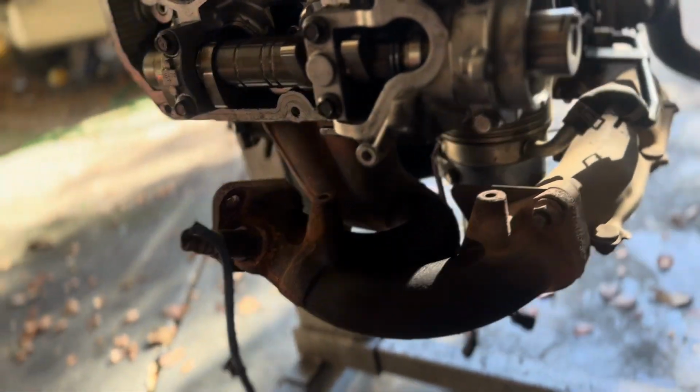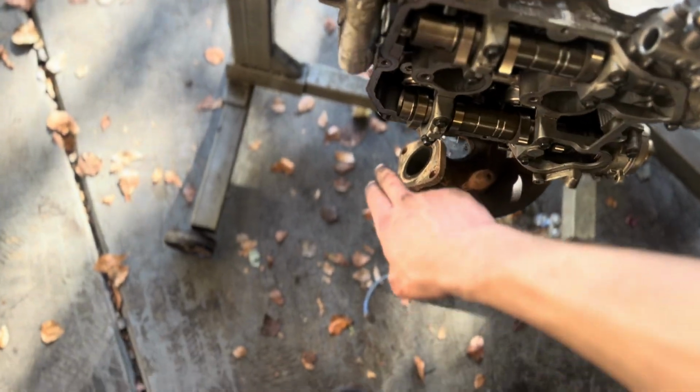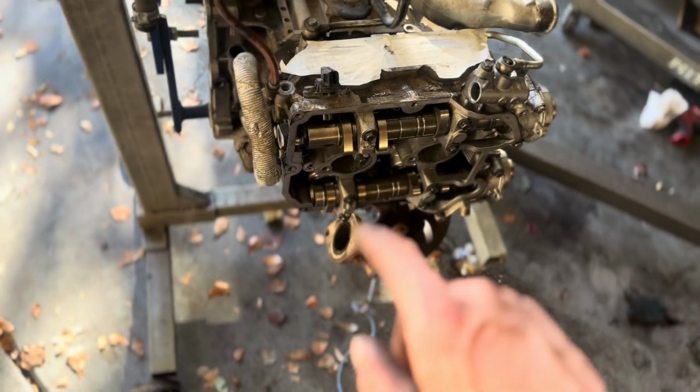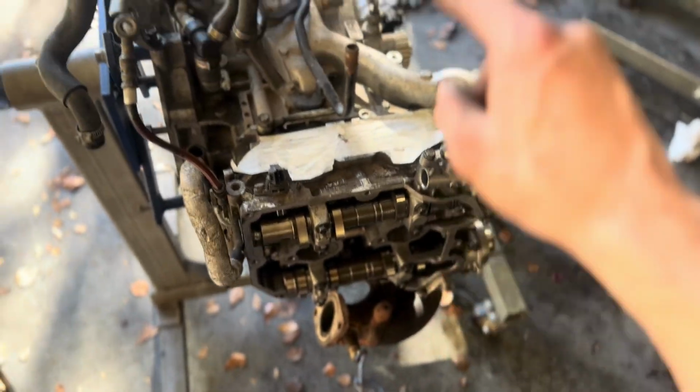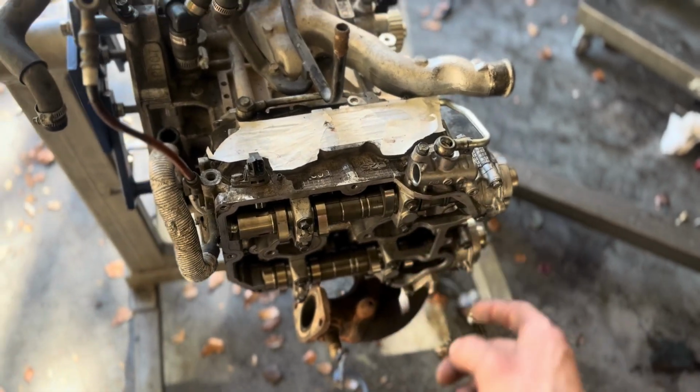0.008. They're like thousandths of an inch or whatever. Anyways, gonna get those done on the intake and the exhaust, measuring them out. I got the exhaust on, just the headers on the bottom so far. We're doing a different up pipe. I have one in my shed that's good condition, so we'll get a new gasket on and then we'll put the up pipe on. But first we're gonna try to get this all handled, to get both sides measured, make sure they're all good to go, and then seal up all these cam holes.